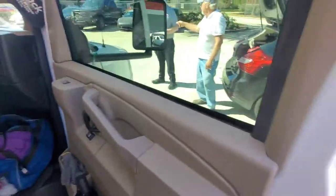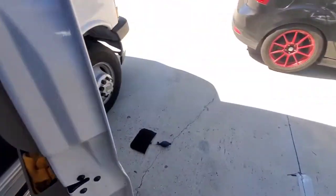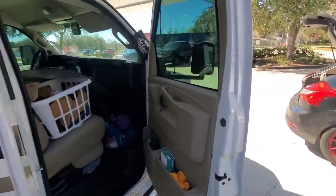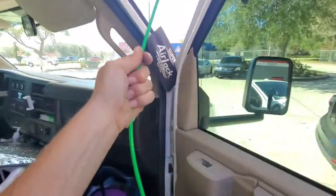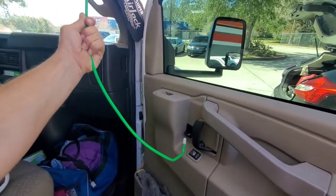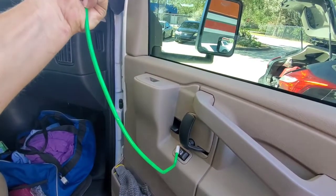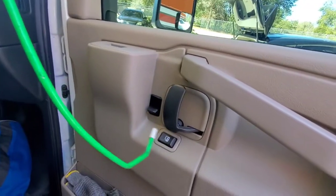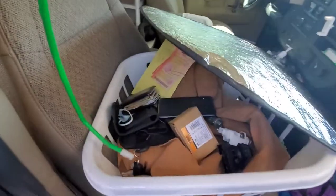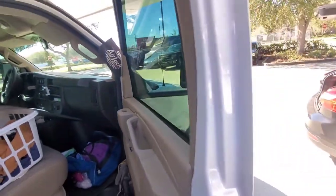Because I couldn't show you with all the stuff blocking the view, I'll show you now. Basically I came in with this reach tool — that lock is like this — coming from the front of the vehicle, hooking it, and pulling up. It's as simple as that. You could also hit the unlock button, which would also unlock this vehicle. And if you can't get those, sometimes you can hook the keys themselves and pull those out — that's another option.